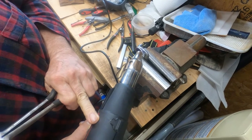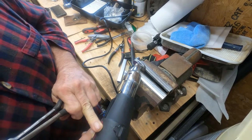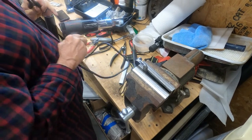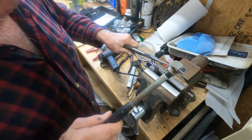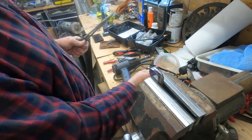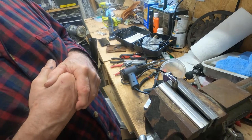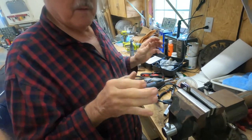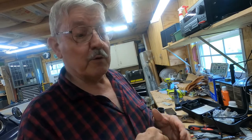Aim away from the plastic and do it for 30 seconds. What that does is soften up the plastic and it doesn't hurt the chrome. At 30 seconds this will go in maybe an eighth or three-sixteenths of an inch, but it won't seem to go all the way through. If your plastic is a little softer it may. So heat it again for 30 seconds more and try it again — just lightly tap. I broke my pin punch because it tapped and tapped and the thing wouldn't go through. Just tap and tap and you'll feel it give once it goes through the plastic.